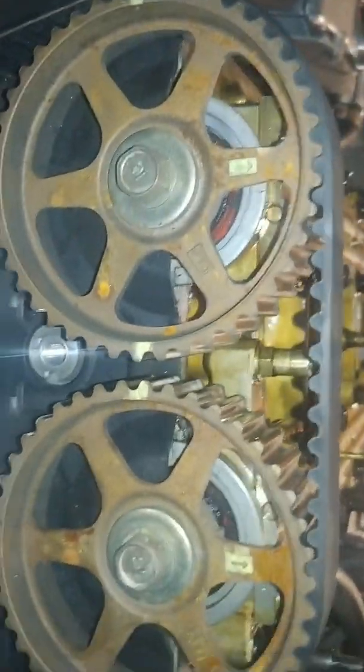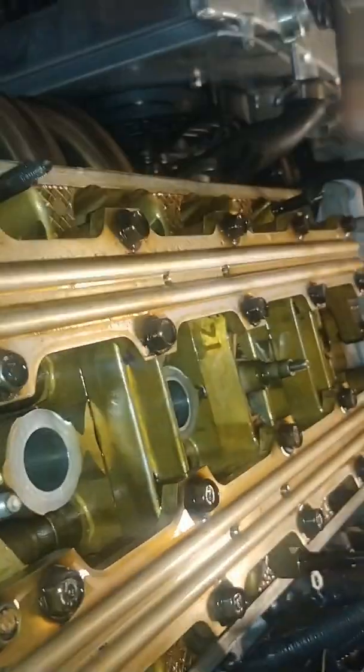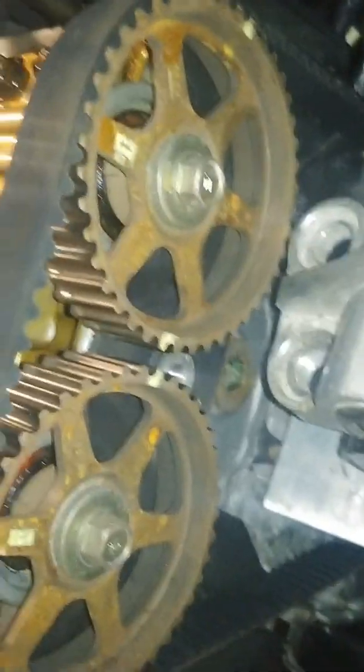So I'm going to put this back on here in a sec. I'll show you up here — stick all your lines. Right, so if you look, these shouldn't be tight. You should be able to just literally pull them back out like I showed you. Same thing. So then you know nothing's binding, everything's where it's supposed to be. So we're going to get this back together and do a rotation, make sure everything's still where it needs to be. Alright guys, we've got the new belt on. We're going to turn it over — I've got the pins pulled, everything lines up. We've got the alternator back on. Let's give it a turn and see how the belt stays.